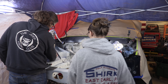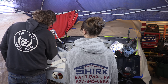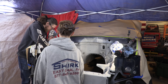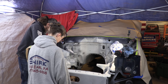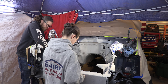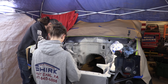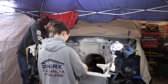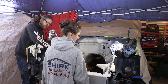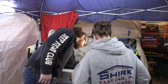So we have to do that to the whole area over here. This over here you can kind of see I've already done it, and if you run your hands down it you can find those spots. Even the non-primed stuff we're going to want to hit with this, because the overspray might be on there. Most of this over here is done — I've already done a lot of it. You don't want to go through to metal; you just want to make it smooth. Like right here you can see there are a couple of high spots that came through a little bit — we're just going to ignore that. But if we have to respray again, I'll go look for them and touch them up.